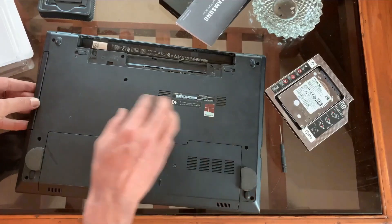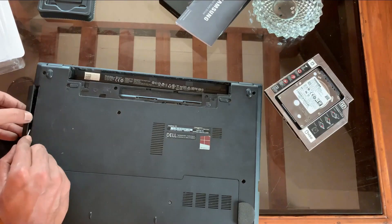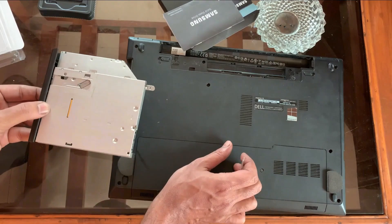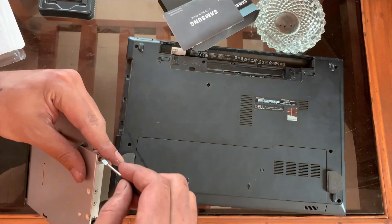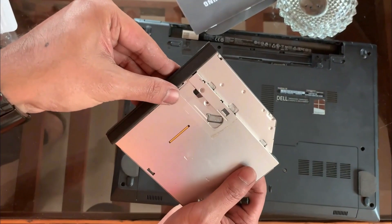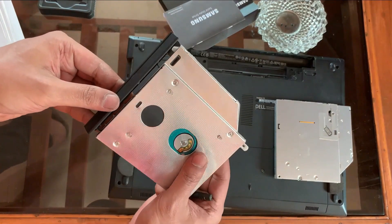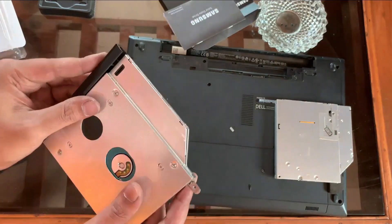Now cover the back cabinet. To remove the DVD drive, unscrew this pin and apply a little pressure to remove the CD/DVD drive from your laptop. Detach this notch from the DVD drive and attach the notch to the new caddy. Finally, detach the front panel from the optical DVD drive and feed the front panel to the caddy very carefully — no need to press hard.